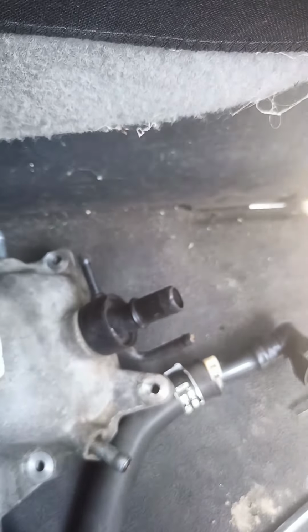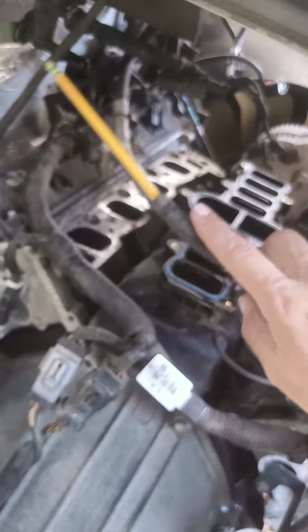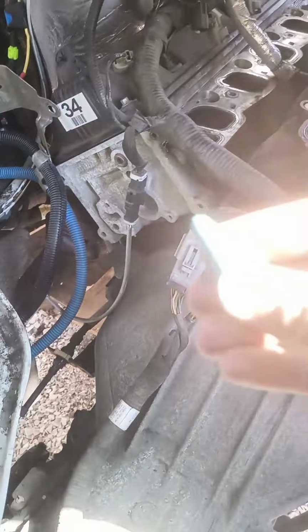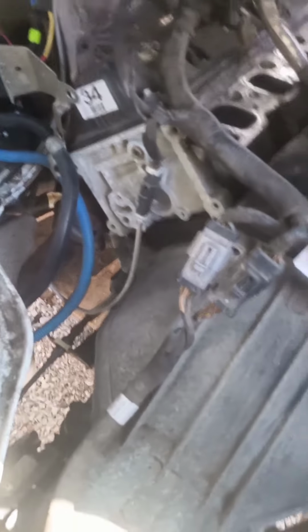Also, you have a coolant line in here and a coolant line in here. I believe I touched base on that. But you do want to make sure you're not getting coolant all over everything. I think I shoved a pencil inside both of these lines to kind of keep them from draining out, but I ended up having to drain it out anyway whenever I pulled the intake manifold. But if you don't have to go that far, you can just shove pencils in it, or caulk tube heads, something like this that's got a harder rubber tip on it than that one.